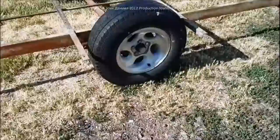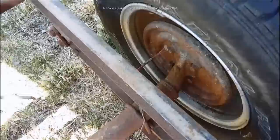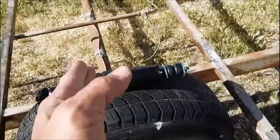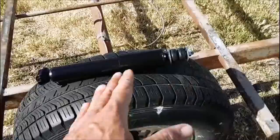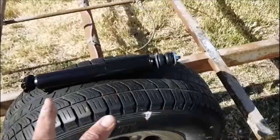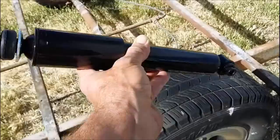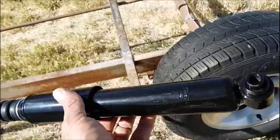It has some nice Ford Explorer rims on it, a 3,500 pound axle with 10-inch electric brakes. We're going to sandblast, clean, and replace all the hardware and internals including the bearings. I'm really stuck on putting shock absorbers on these trailers. A lot of people think that's silly, but if you use yours like I do, you chew the tires up — they just get shredded because when you're empty they just bounce. Even little road expansion joints eat your tires up.